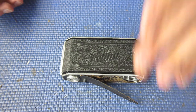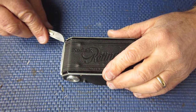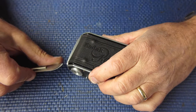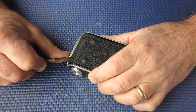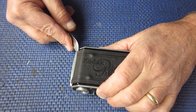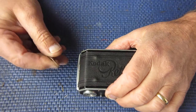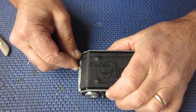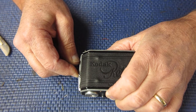I'm going to remove the leather from the back of this camera and deal with these Zeiss bumps. I'm just checking, sliding my scalpel under the edge of the leather at this end, just seeing what sort of a state it's in, seeing how well it's fixed. I'm just running a small sharp screwdriver underneath that very edge, and I'm being careful to feel for any reluctance for the leather to come away.